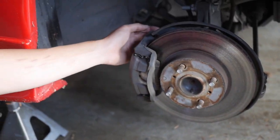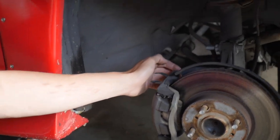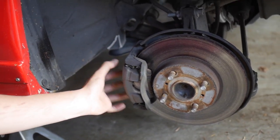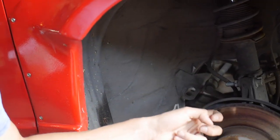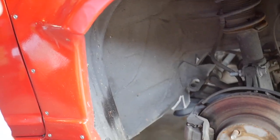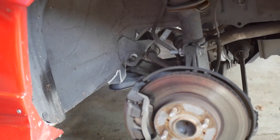I'm going to take off the two bolts holding the caliper bracket, because on a normal brake job like I'll do on the rear, I would normally just swing it up. But because I'm replacing the rotor, I'm going to take off the entire caliper and then zip-tie it to the spring just so it doesn't dangle and put pressure on the line.